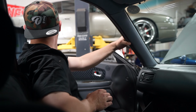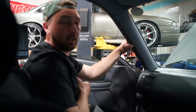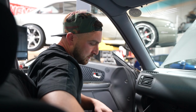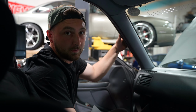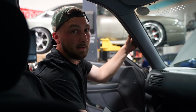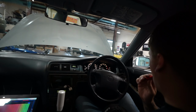It was crazy. Let's see how much boost we made. So we made 447 horsepower and 428 torque. Wow. Right? So checking the log, 14.5 PSI, and it ramped out to like 15 and some change. Peak torque this time was 430, which is good where I'm at. Yeah. I'm happy with that on pump. Yeah. We're gonna try to make that torque more flat, and it should bring us up to the high 400 horsepower area. It is quieter in here, Tony.